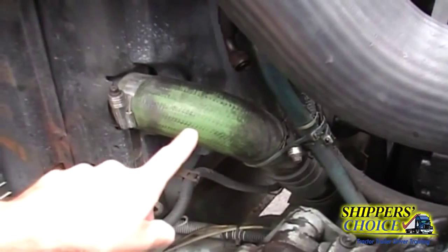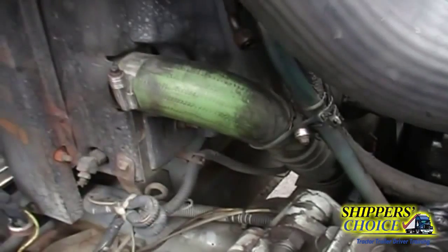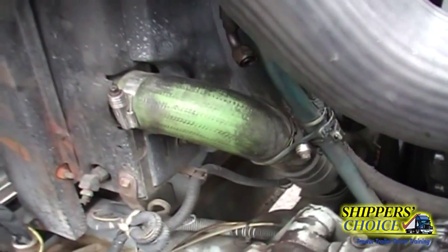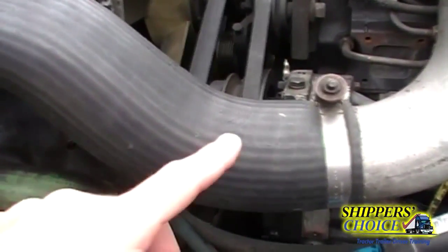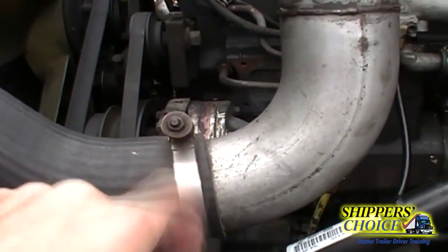We're going to go inside the engine bay. There are a couple ways you can go — top to bottom or bottom to top. I always go bottom to top. My lower radiator hose: the rubber portion is not cracked, dry rotted, or broken; the metal portion is not cracked, bent, or broken; fittings are tight and I see no leaks. My air intake hose: the rubber portion is not cracked or dry rotted, the metal portion is not cracked or bent, fittings are tight.